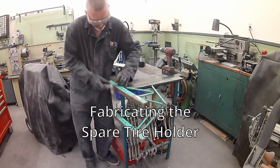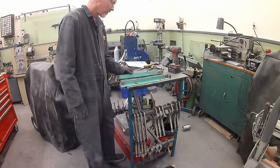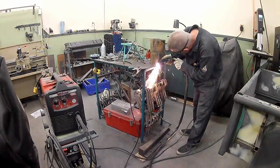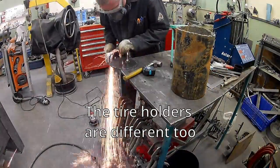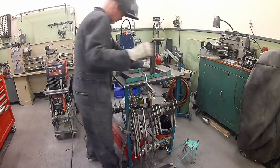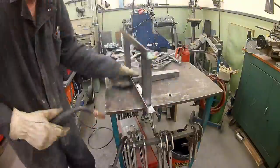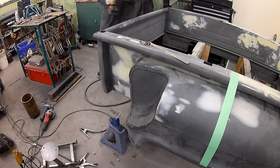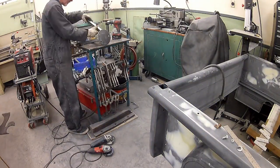So since I'm running out of time, I think I'm going to fabricate the spare tire holder. The reason for this is this used to be a long bed stepside, and the stepside fender that carries a spare tire is different between the short bed and the long bed. But I'm not interested in buying a whole other fender for this thing. And if you have the right size diameter wheel, you can squeeze a spare tire in there. However, if I'm going to be laying down some primer, I need to know where the holes go to mount this thing so that they can be primed inside there — I need to know what the bracket looks like and I need to mount the wheel.